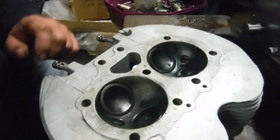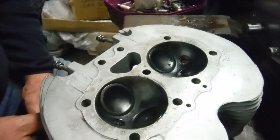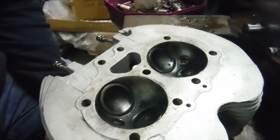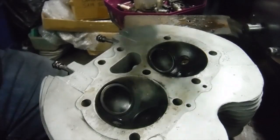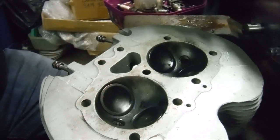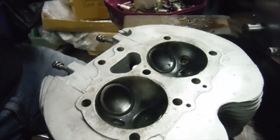Right, I've come up with an interesting one here with this BSA A65 cylinder head. I won't be worrying too much about which valves go where initially, but I may have found what the owner was describing - the noises he reckoned he heard coming from this engine. The crank was checked, had a re-grind, but was only half a thou under the minimum for its size - so not in bad shape. Seeing as it was all apart we had it re-ground to the next undersize just in case, but it's unlikely that was making the racket.